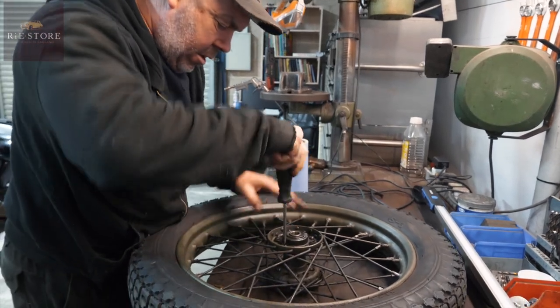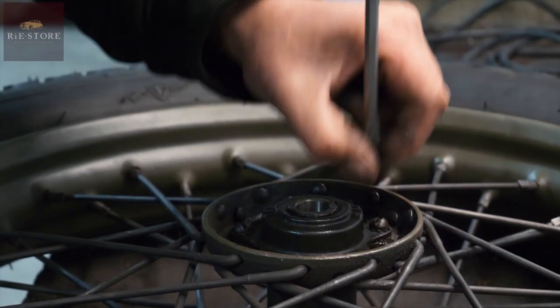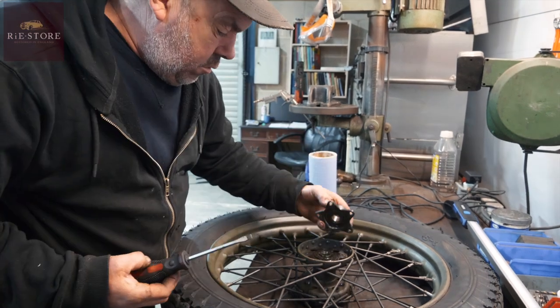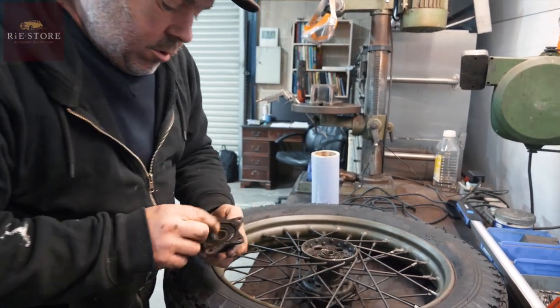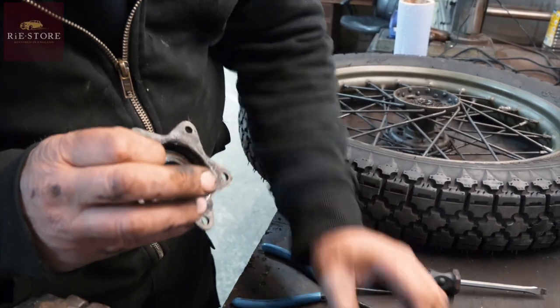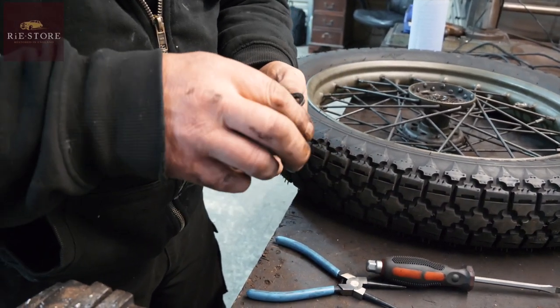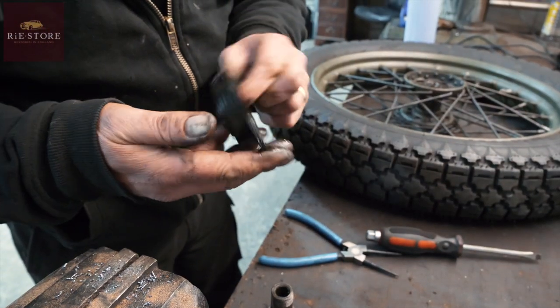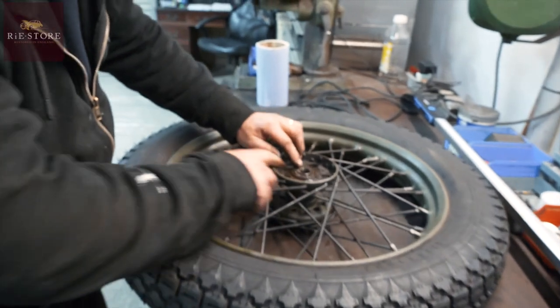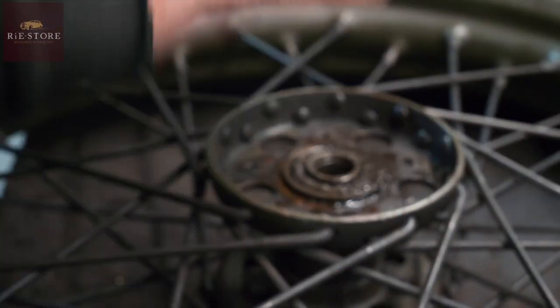Let's take off what I call the star hub. So where does the play normally come in these wheel bearings? I can show you when I get this off. You've got a locator to stop that spinning, so it sits on the bearings there. Then you've got shim washers, a hub section, and then more shim washers in there with an oil seal, which we won't endeavour to get out but we'll soak in petrol to soften it back up. Basically the shims push those bearings to take any play out that way.